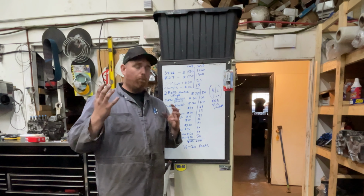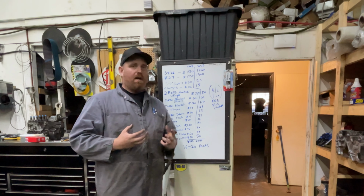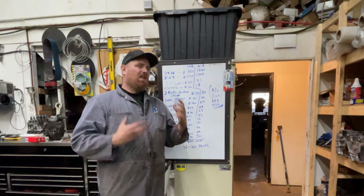That's the big thing. And lots of people seem to have the notion of, oh, I have to do it like this. There's like 50 different ways you could do it. It just depends on what you want and how you want it to work. If you want it to work really good at low RPM, this turbocharger works great. If you want it to work at higher RPM, you need a bigger turbine wheel. So you can use an even smaller compressor wheel with a bigger turbine wheel, and it'll still make more power because you have that compounding effect. So there's lots to compounding.